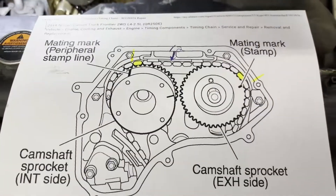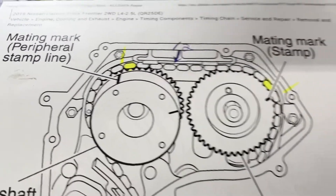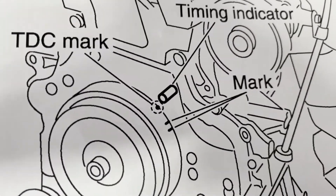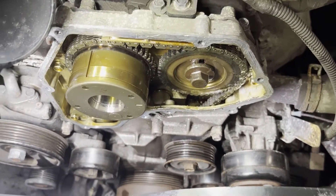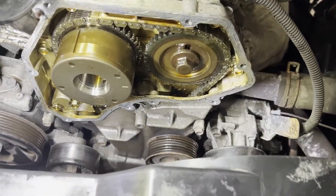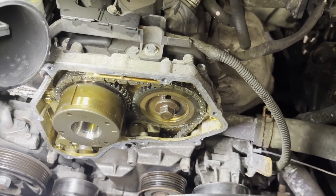That's all outlined here. Just get yourself a service manual of any kind, or you can download this stuff online sometimes for a small fee. You're going to see how they want this thing lined up up top, and you're also going to see those three marks I talked about for the TDC — ignore the forward marks, go with that one. It's really not that hard. It's going to be harder if you have this engine in a car because the engine is going to be transverse mounted. I'm lucky that this engine is front to back, so it's easier to get in here without ripping everything off, but you will want to take your serpentine belt off and your air snorkels off that go across the front. Not too difficult. I hope this is helpful — it's all about checking to see if you skip timing, and then the repairs come later. Thank you.